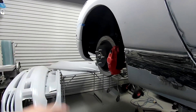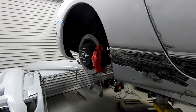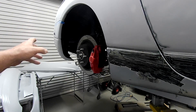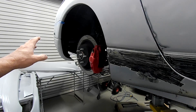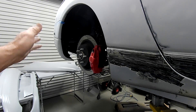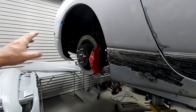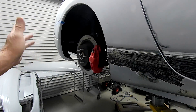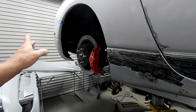Bumpers are already done. That one out there — you can see it's kind of done, but it's a different scenario doing the bumpers. The stone guard pattern on the bumpers is actually molded into them, so you can't strip that off. You actually have to sand it out because it is part of the plastic on the bumper, then prime with high-fill primer and epoxies over the top and rub it out to get rid of it that way.